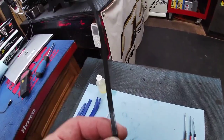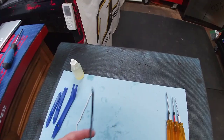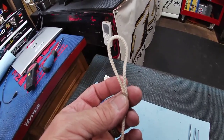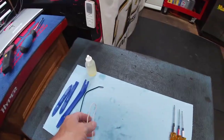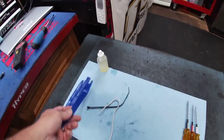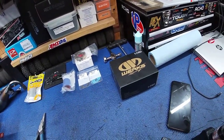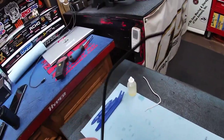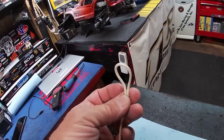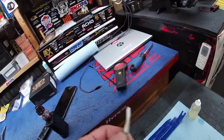If the sleeve won't come up, you can use a zip tie, but I don't even like using zip ties. I use a plastic tool to coerce the rod over when getting it off the crank pin, and then use it in the exhaust port to pop the sleeve up a little bit. Bring the piston back down, get it out, then use plastic tools to pull the sleeve up. Never use screwdrivers or metal tools. Use 3/16ths nylon rope — it's non-abrasive, does the job, won't hurt anything, and won't clip off and leave a piece inside.